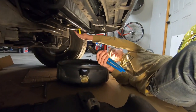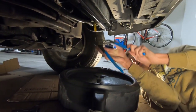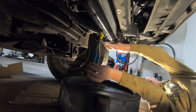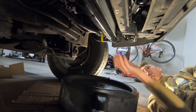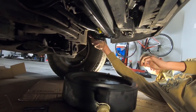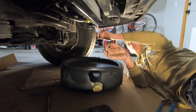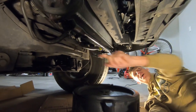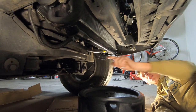First, we're going to take off the bottom hose on the right side. It's a little clamp — you can use vice grips, grab it, put them right on, squeeze, pull back the clamp, just like that. Then pull off the hose. Be careful — coolant will come out. Ours is mostly drained already from our first go-around, so you'll get a lot more than that normally. If you want it to drain faster, you can drain it from the little white tab first, then make sure the vehicle is cool, unscrew the radiator cap, and it'll flow better.